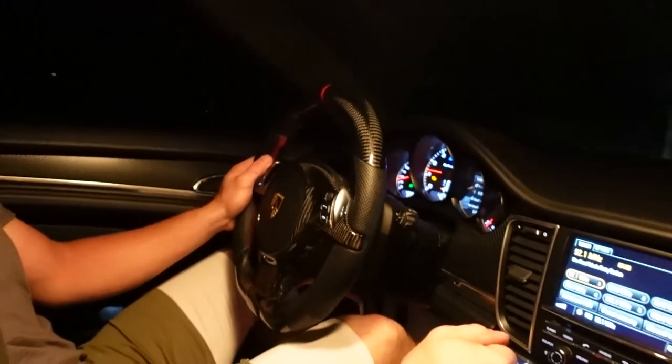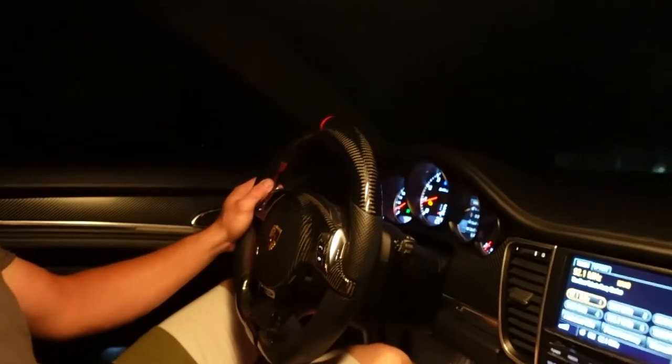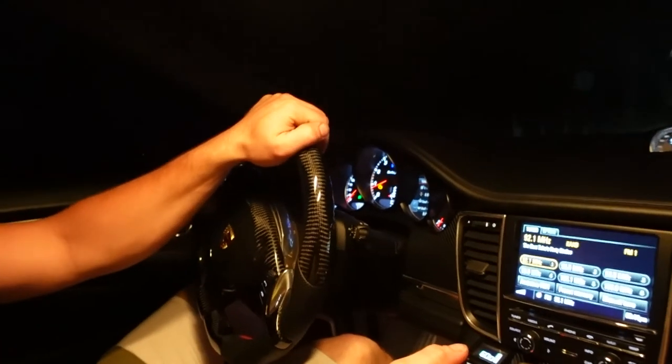Watch it not work right now. Like, watch it trip the code instantly. It does that sometimes. We kind of noticed how sometimes it'll work, but that's rare, and then all of a sudden it'll just quit working. So if it's working, that means it's kind of all software. The car is detecting if something's off and putting in a limp mode, not giving you boost. Does that make sense?